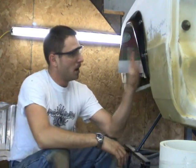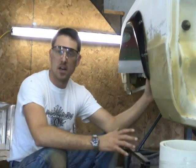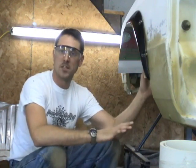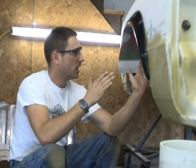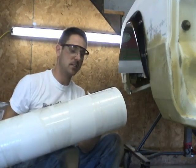Right now I've mocked up the flare, and I'm trying to do my plastic liner on the inside that I had mentioned before. What you do is you get it kind of roughed in with pizza box — you put the pizza box in there, piece it up, and then you cut the permanent piece out of a nice roll of high-density polyethylene.